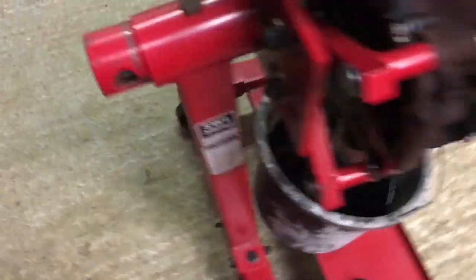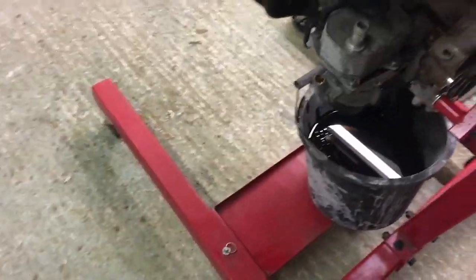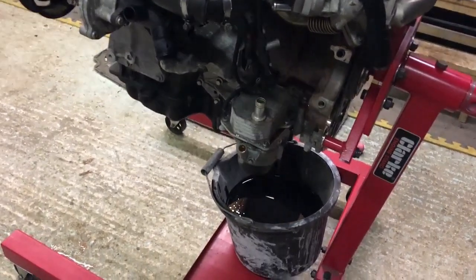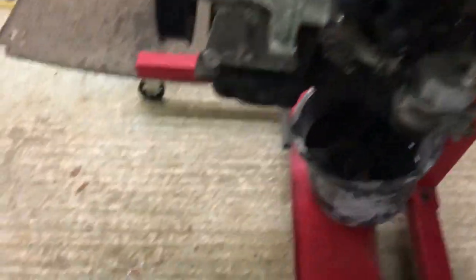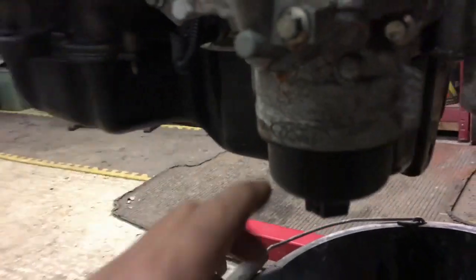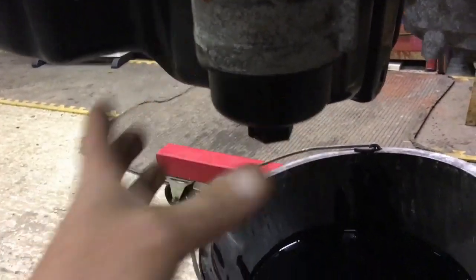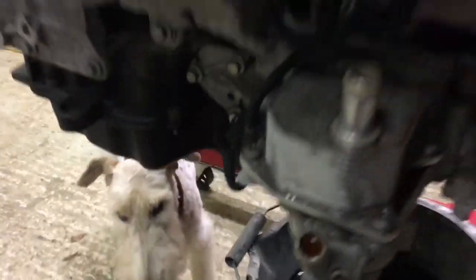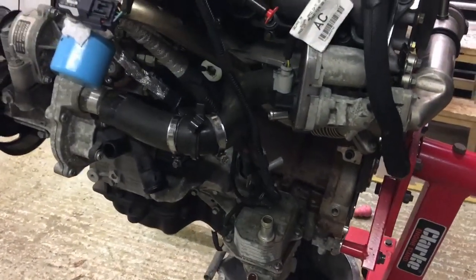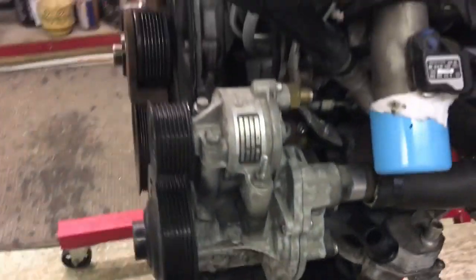Engines on the stand, oil drained. A word about the dog - when I was doing a service in about 2015 she drank the dirty oil sample. Apparently because it was synthetic not mineral it was absolutely fine, just some medication and a very black oily bottom for a few days. A tip: I've taken the plastic oil filter canister out but always put the plastic canister back in temporarily even with no filter in it, so it doesn't expand and then not fit again when you need it.